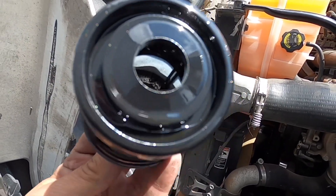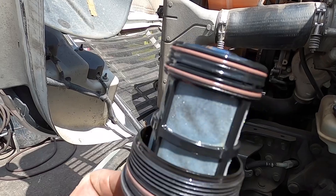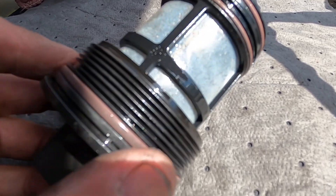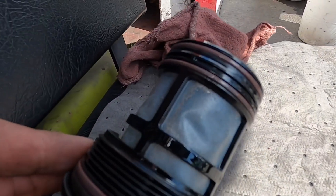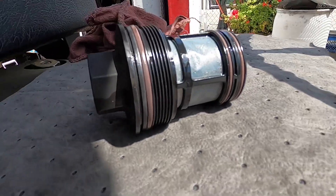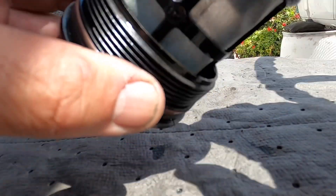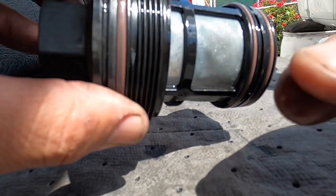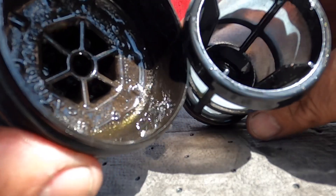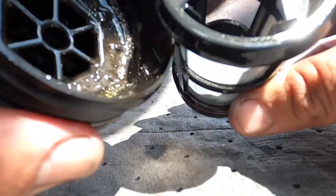This one is a two-piece. When you pull it out and inspect it — the whole thing is just full of glitter, shiny shiny glitter, not big chunks. That tells us this pump is no good and it's officially done. I'm going to pour the contents out on a piece of cardboard so you can see what we found. Look inside — see how shiny all that stuff is? That tells us this pump has officially started to leave the building.